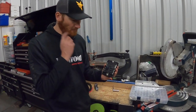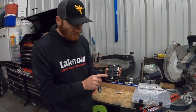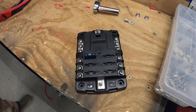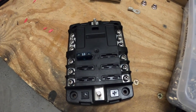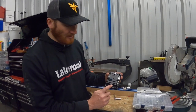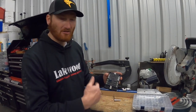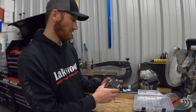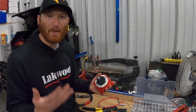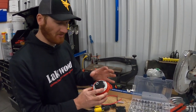For powering accessories — in this case just electronics — we're going to use a distribution panel. This one is a Blue Sea, which is a really good brand. The negatives are up top and the positives get individual fuses. You can label up to six circuits with the cover, which is nice. We also need to make a jumper from the battery to the battery switch. I chose a battery switch with positions one, two, and off, which gives more options for the future and is heavier duty than a simple shutoff switch.